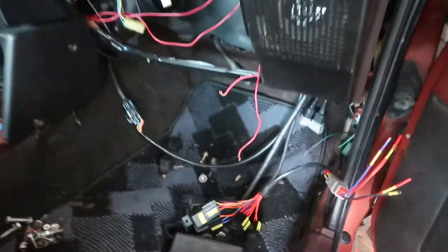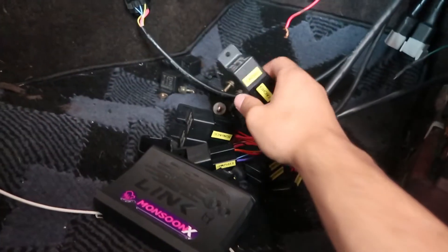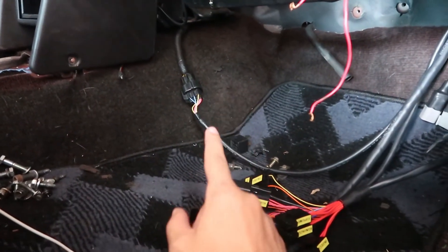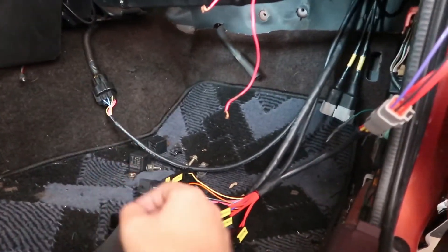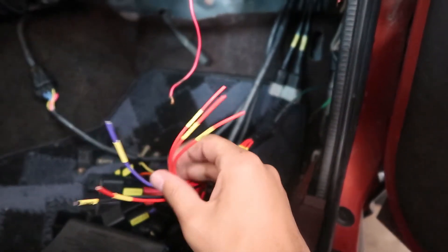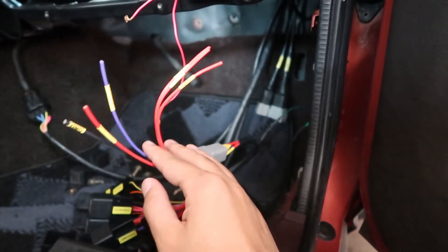For the inside, I've got everything hooked up — the Monsoon link hooked up, all the relays are hooked up, fuses are already in. We've got the big black plug. The last version of the wiring harness was missing that, so we've got that now. The last thing that needs to be done is these wires right here: this one goes to the fuel pump, and all three of these go to the direct battery — or in our new case, I think the alternator.